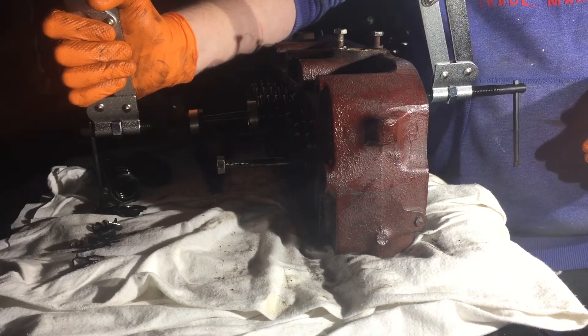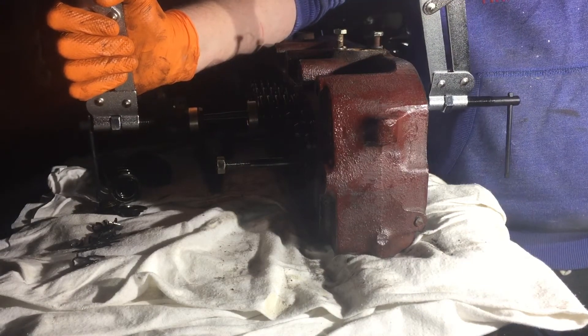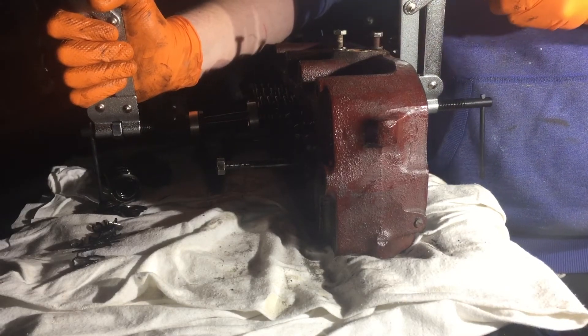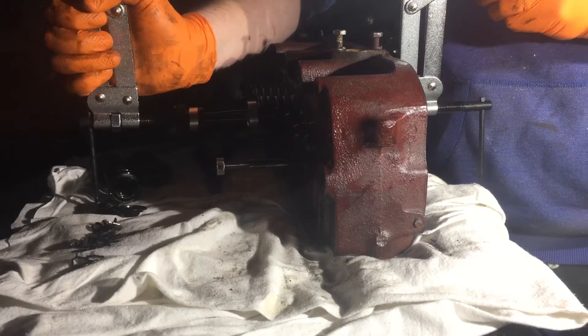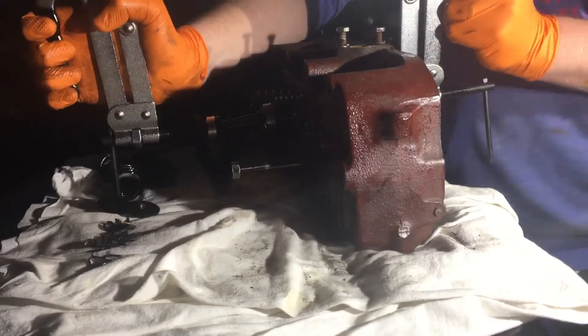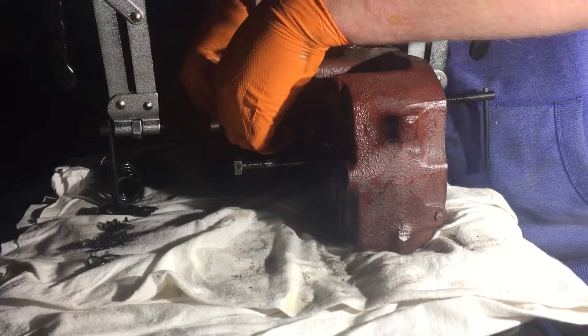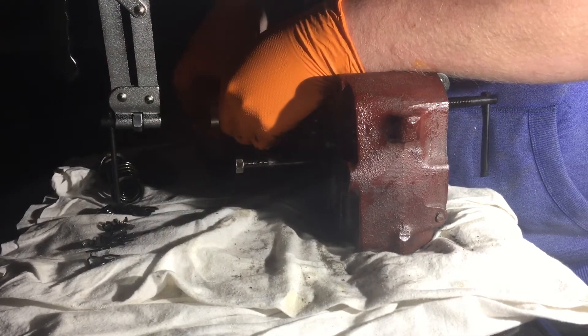As you can see, I've got that seated firmly on the top. You move in the bottom arm — that engages. Then what you want to do is compress the valve springs. You can see it's compressed there nicely.